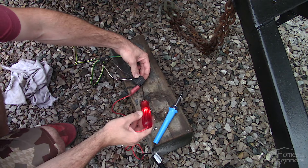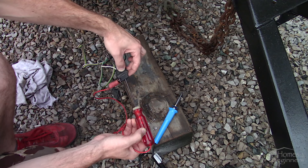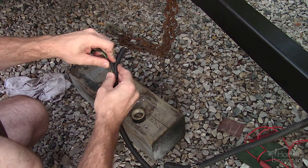This is a four wire system. The green wire is for the right signal, yellow is for the left signal, brown is for the parking lights, and white is for the ground. Green and yellow also function as the brake lights.